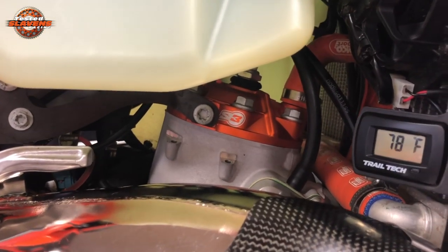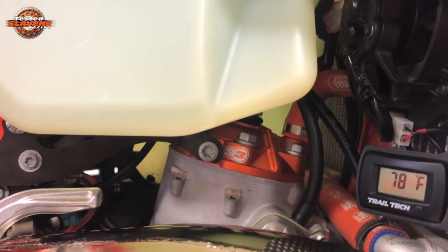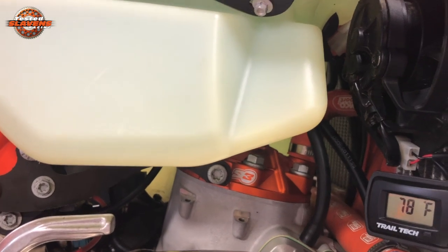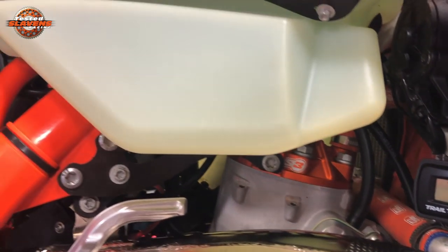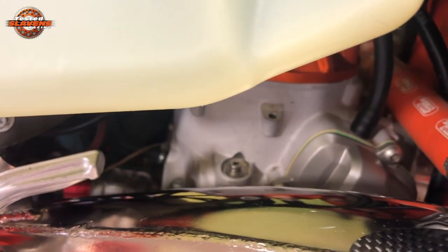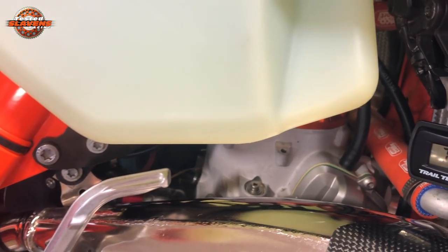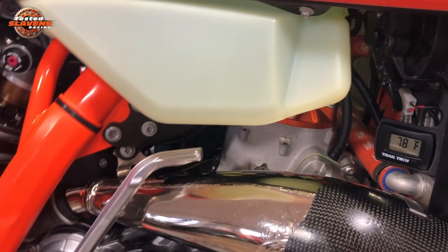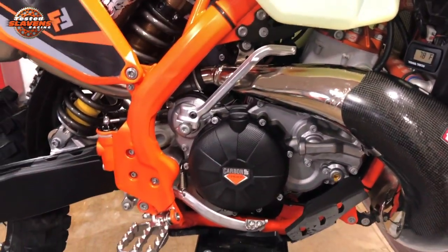And then you'll see the Slavens Mule S3 head. That's our own proprietary insert designs, the dome part of the head, not the shell. And you'll notice right there a plug where the injector goes. Well, I've removed the injectors and relocated them with a Get race kit, and I'll get to that in a minute when I get to the other side of the bike.